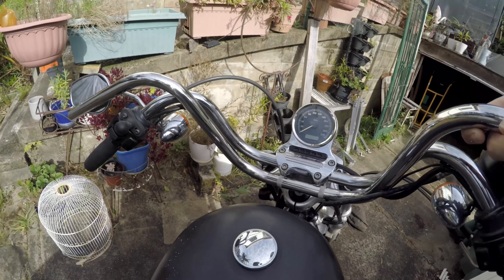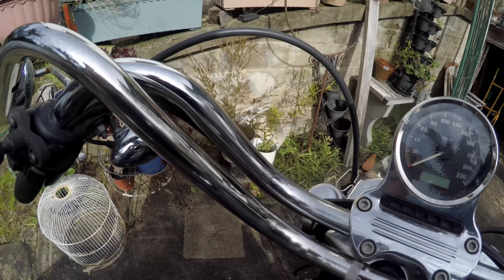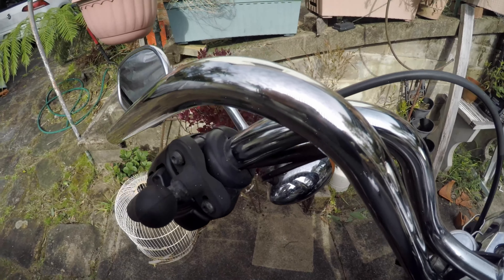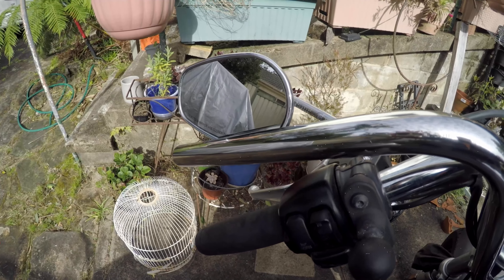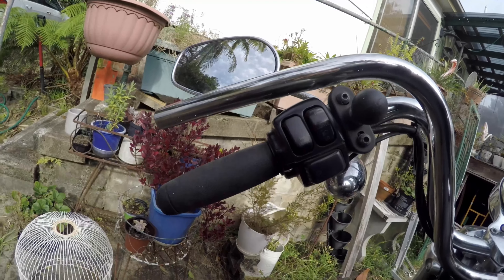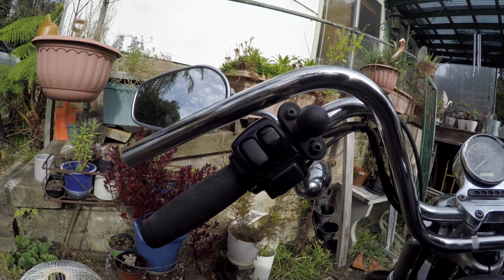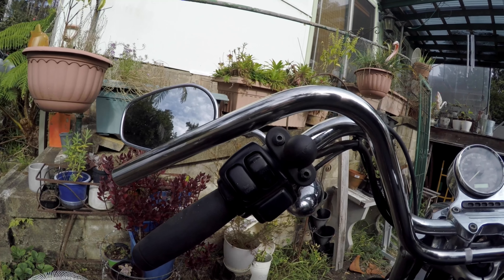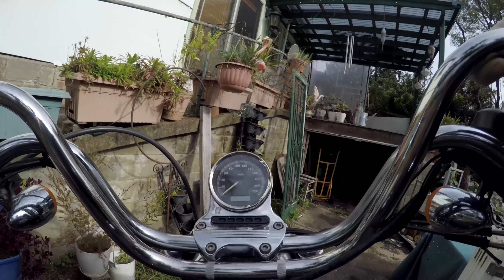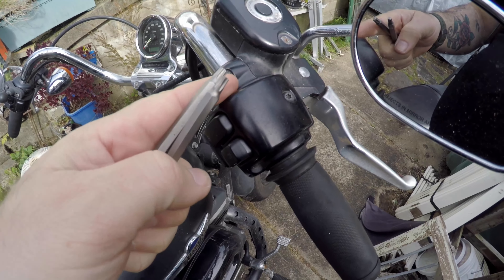I've just put the bars in place - not in the right position yet, but you can see a couple of differences. It wasn't so much the height - on my 2013 Sportster Custom 1200 the standard bars aren't that much lower, only about three inches difference. The main thing I wanted is the angle - notice how the angle of the new bars compared to my stock ones is different. That's going to help with comfort because I prefer a straighter bar, and it also brings the hands up a few inches higher. It's looking pretty good so far, and I think I may have enough cabling.